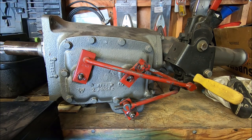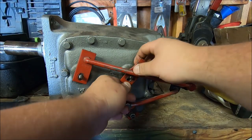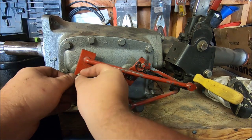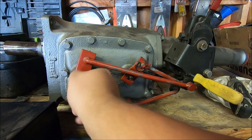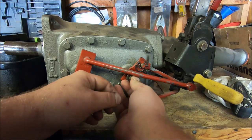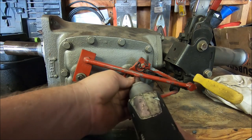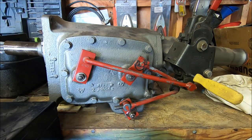You know what, this is actually pretty simple - this was a lot more easy than expected. Basically what you want to do is get all of these things adjusted until they fit real nice. And this will apply to a GM Muncie transmission or any Mopar 4-speed. I don't think it would apply to a top loader because it's a whole different system. But yeah, this is basically all you got to do to adjust your Hurst shifter on your 4-speed. What that screwdriver does is lock the shifter into neutral, and that's where you need to adjust the shifter from - from neutral. That gets everything right in line.